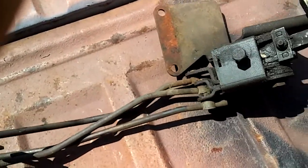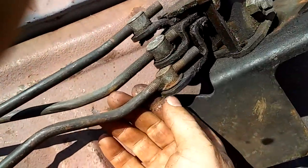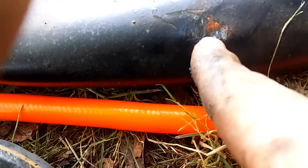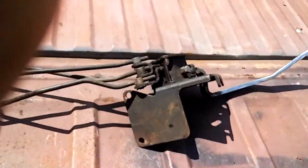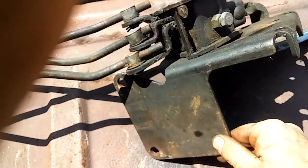The other issue I've got too is my shifting rod — the reverse, which is this one right here, up in here where my thumb is was rubbing that cross member. My new one's got all the right shifting rods and everything, and I'll get rid of that spacer because I was looking at pictures of other '67 Chevelles that have got four speeds and stuff. This one's a Saginaw, but I've never seen one with a spacer, so I don't know what's up with that spacer.